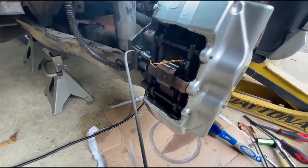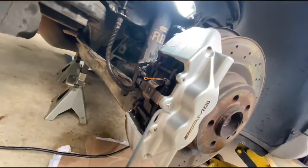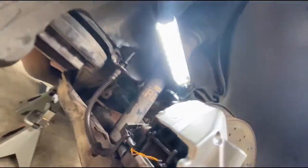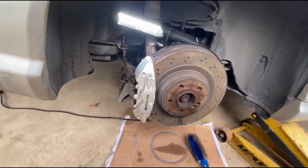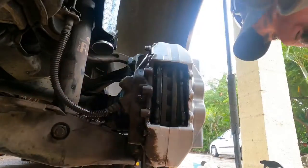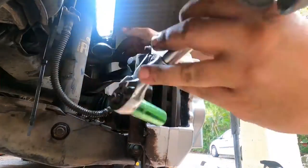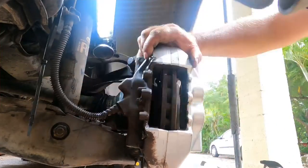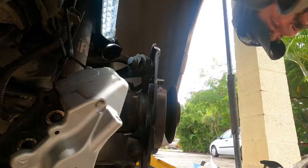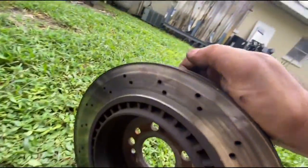What we've got to do here is remove the sensor, and then there's an 8mm bolt that needs to be removed to take this off. Then we can knock these pins out with the punch. Once we remove them, there's two 18mm bolts back there, and we're going to use zip ties to hold up the calipers. Got it off — took a little bit of beating, but there's a bunch of brake dust in the middle and you can definitely see that lip in there.